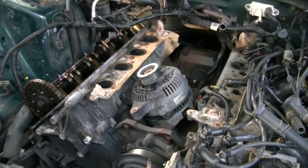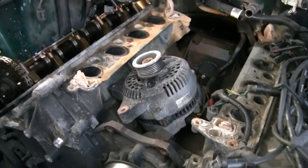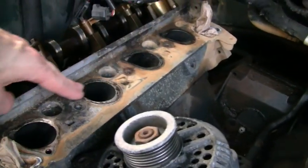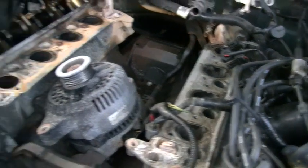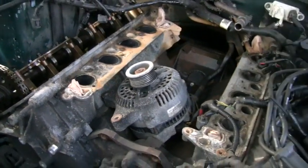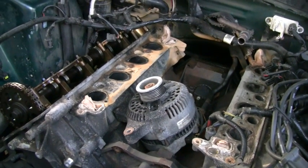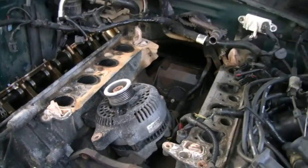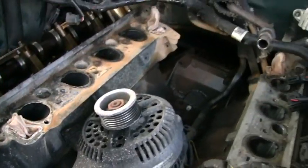Just a few pointers: if you're doing this with an engine that's totally assembled, you really don't have to worry about it. But since my engine is disassembled, I put a bunch of rags inside my manifold ports so that way dirt didn't get in there. But obviously if you're getting ready to crank the engine over, you definitely don't want anything in there because it could get sucked into the engine — and that would be no bueno. So if you have the manifold already off, make sure you don't have any rags in there.